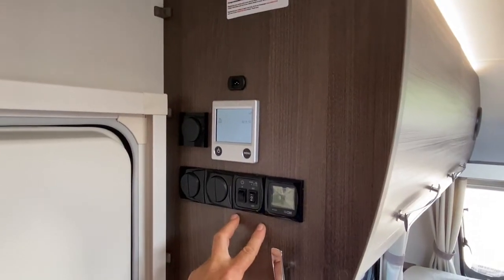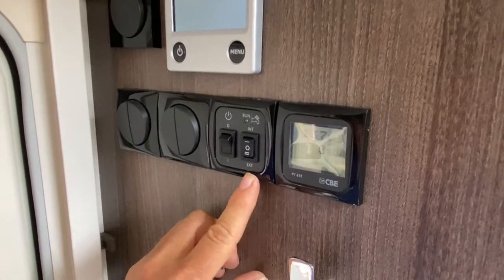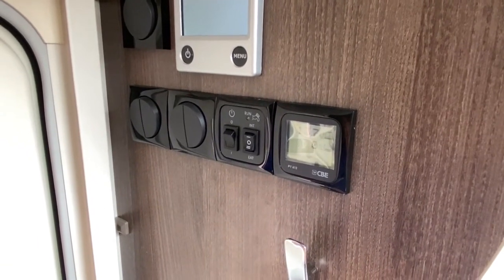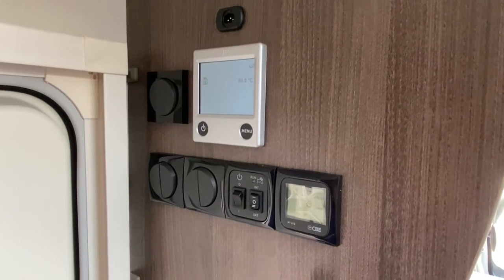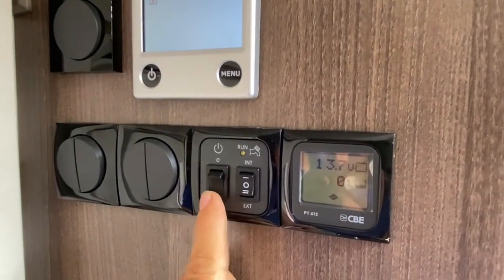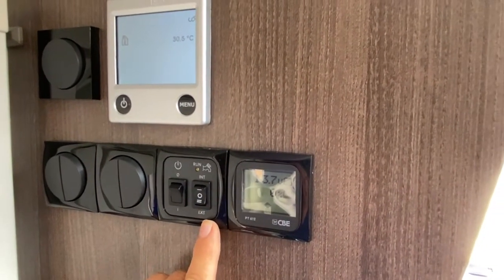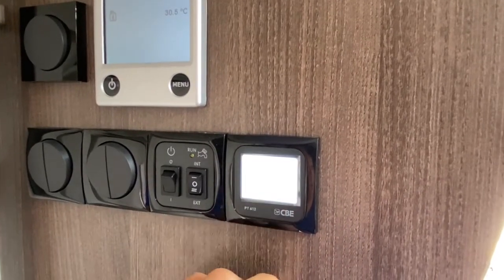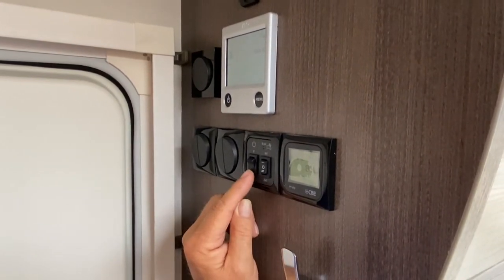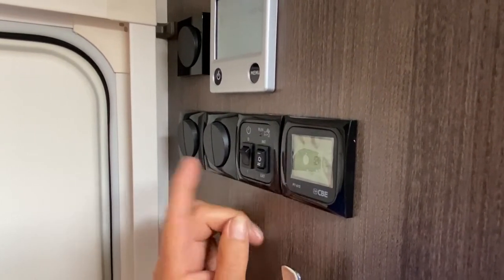The next one along is your water system for the caravan. You've got your isolator switch to the left and a rocker switch to the right. The Buccaneer has a fresh water onboard tank, so if you're caravanning during the winter you can bring water onto that tank and stop it from freezing. You can also bring the water directly from your water barrel to your taps — the rocker switch in the middle on zero, and this switch on, will bring the water straight from your barrel to your taps. If you want to fill your onboard tank, just press it down to external. That will fill the tank with a 40 litre capacity. When you want to use the onboard tank, leave the isolator switch on, turn it to internal — no messing about with valves or changeover valves. It's all done by solenoid, so it's just a simple one, two, three step.